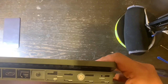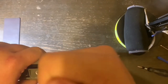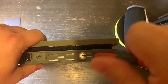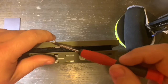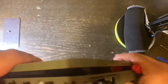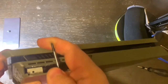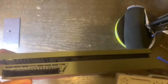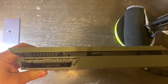As you're taking off the cover to get access to the hard drive, you're going to use a Phillips screwdriver and take off this screw — a lot of people call it the PlayStation screw because it has a lot of symbols and icons on it, but it's just a regular Phillips screw. Then there is this plastic tab that you're going to want to pull up, and then you pull your hard drive out of the PlayStation itself. Lay it to the side somewhere safe where it's not going to fall.